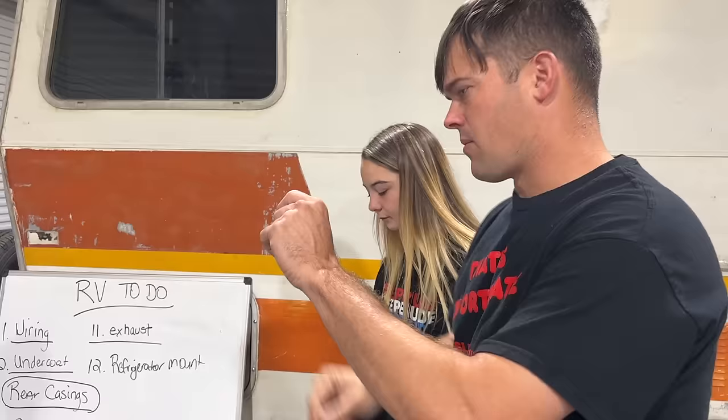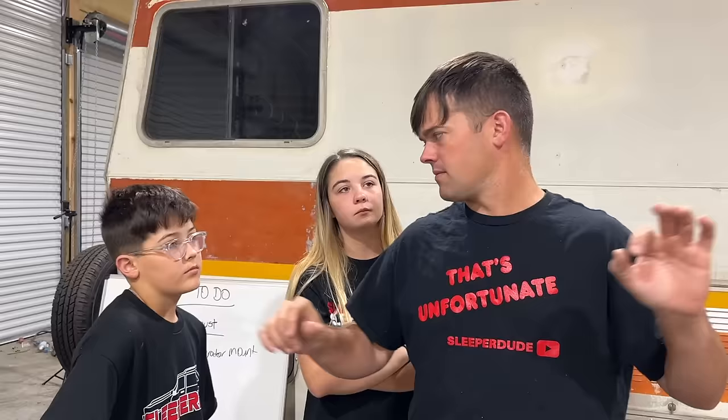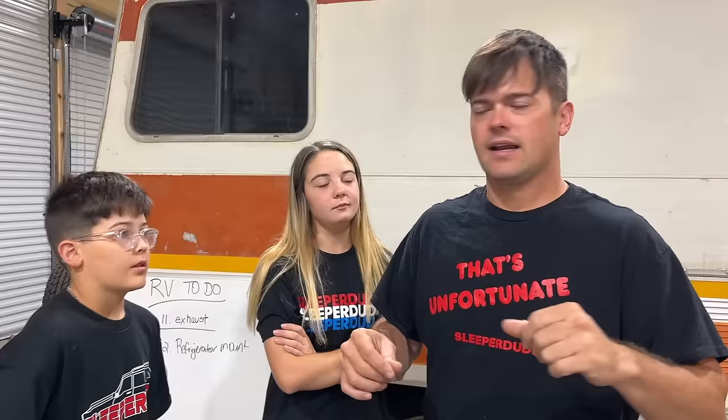We already pre-ran the wires for the taillights behind all the insulation, if you remember. I just gotta drop that wire down. I actually bought a trailer brake wiring kit because it has all the wires you need for taillights. Hopefully it's long enough to go to wherever the source is. I gotta find where the factory wires are and splice into that because all that stuff is cut.